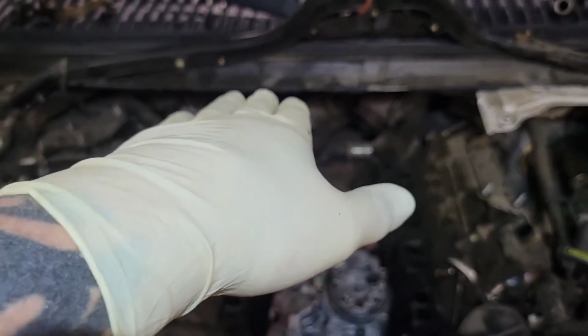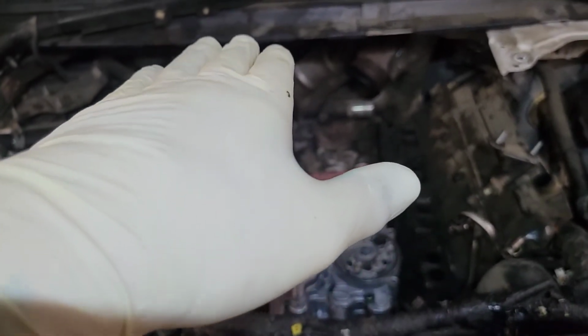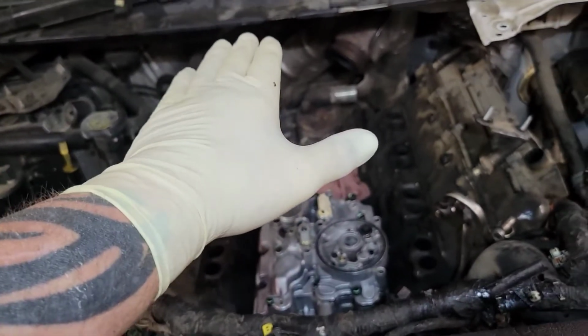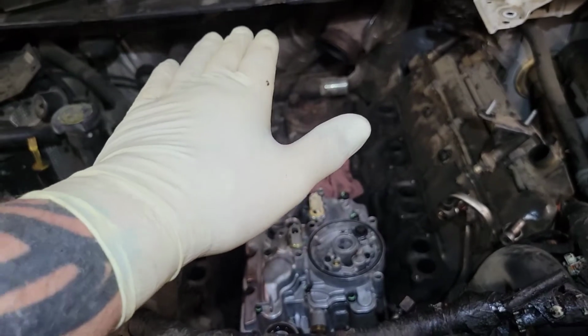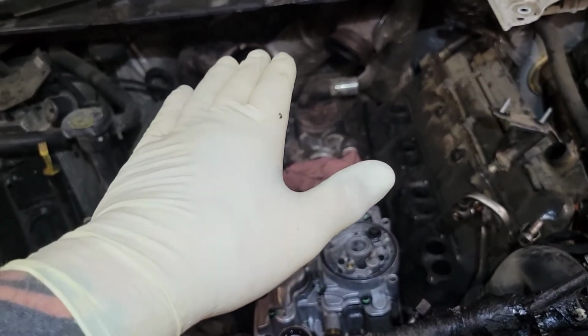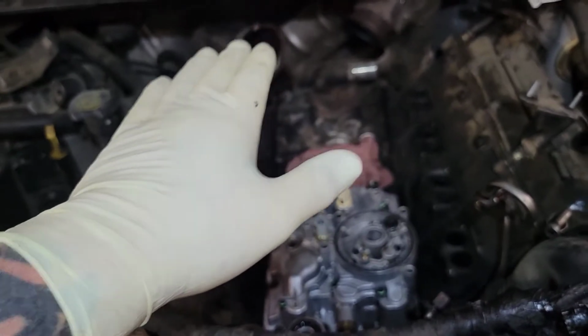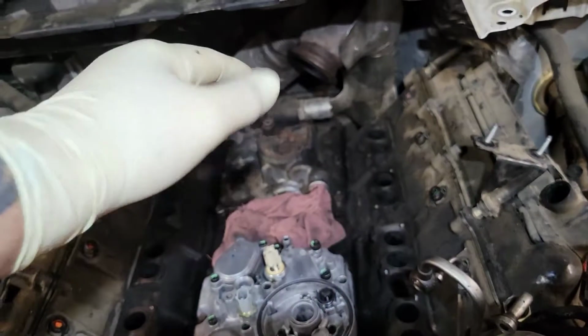You have to take the intake manifold and go down at like a, I don't know, 30-ish degree angle. And you have to try to get the EGR cooler to go into the pipe, the intake to set down properly, and get under the turbo outlet. Put a jack under the exhaust pipe in the back by the cat and jack it up. It'll stay out of the way and make it easier.